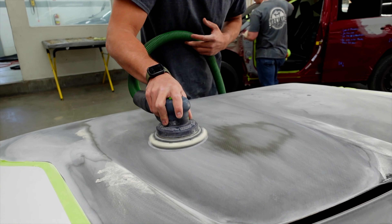We're going to mix up our clear coat. We're going to be using PPG EC 530. If you look on the side of the can you can see what the mix ratio is — it's three to one to one: three parts clear coat, one part hardener, one part reducer. For the clear coat application we're using the Iwata LS400. We're going to put basically two and a half coats on — the first coat is going to be a tack coat, and then we're going to go in and put two heavier flow coats on. Before we shoot the clear coat, we're going to use this tack rag — it's a sticky rag that picks up any little dust that might be on there and gives us a cleaner finish.